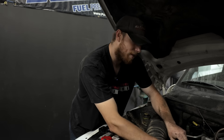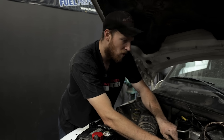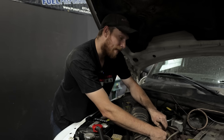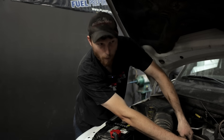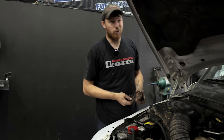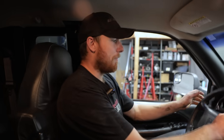So we just tightened up the gate on this factory HY and put it right back in — no other change. We're gonna dyno it again. I'm gonna say it's gonna make the same horsepower, maybe like five or ten more, but boost is gonna be way up. I don't really think this engine in this situation really needed more boost, but we're gonna find out.